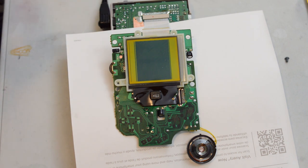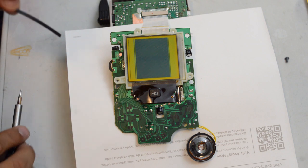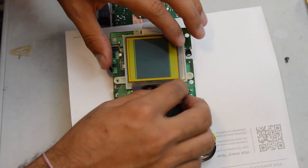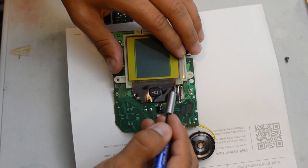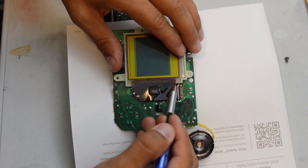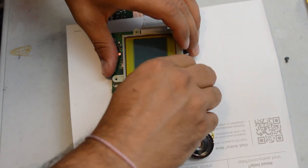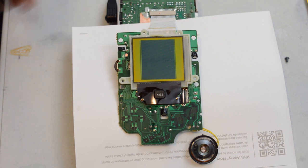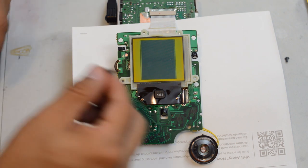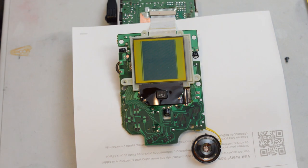You're going to need a very small flathead screwdriver to pry off just the end of the little bar here and remove it. You'll see there's some double-sided tape holding that bar down — it's important to remove it because we're going to apply the soldering iron, and you don't want to melt that tape into the ribbon. Don't be scared if the lines increase when you remove the bar; it's normal because that little piece of rubber was applying pressure to the cable keeping the solder points in contact. That was Nintendo's solution back then.